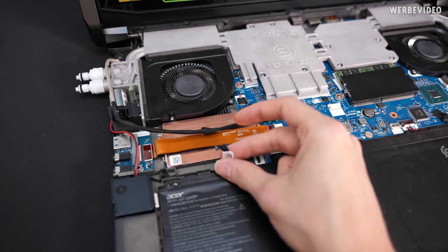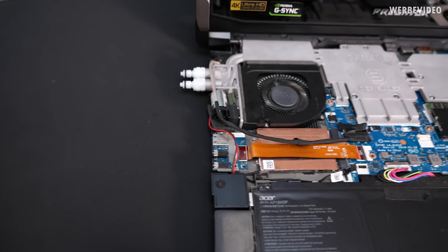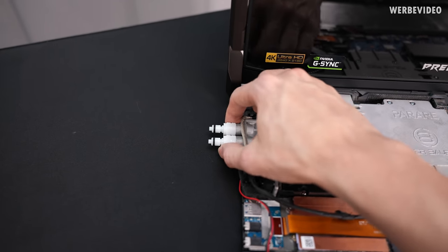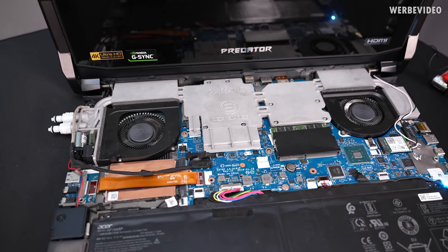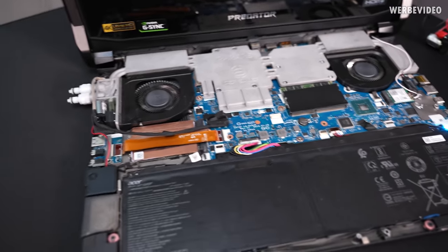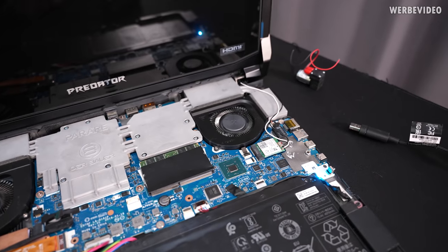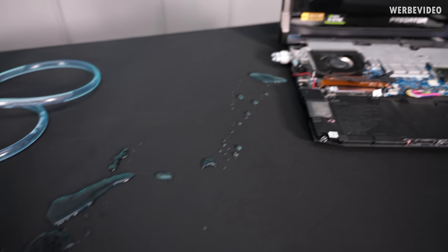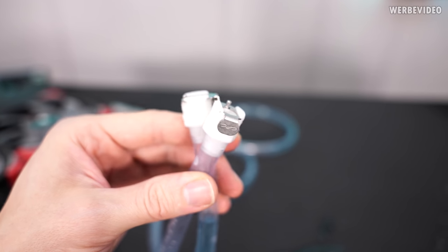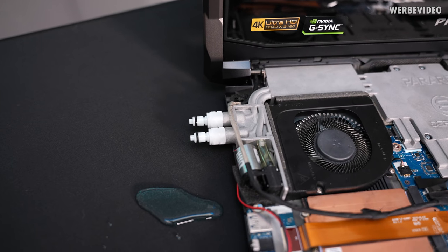Removed the cover again to disconnect the small cable connecting the internal pump. For any real-world application you'd place a switch somewhere, or design a switch that disables the pump whenever you plug something in. With the external water cooling loop we don't rely on the fans anymore and could even completely disable them — it shouldn't make any difference. Hooking up the external cooling now — that was close, I thought those parts were self-sealing but the quick disconnect at the notebook end almost failed.